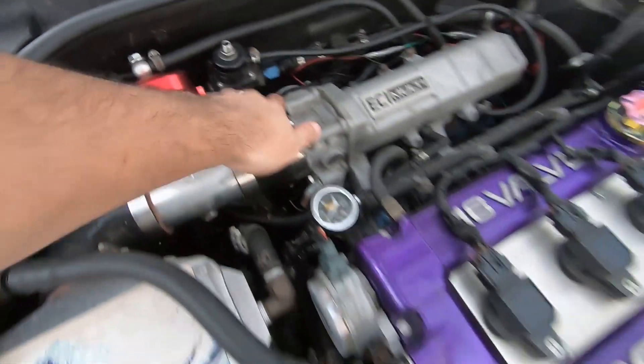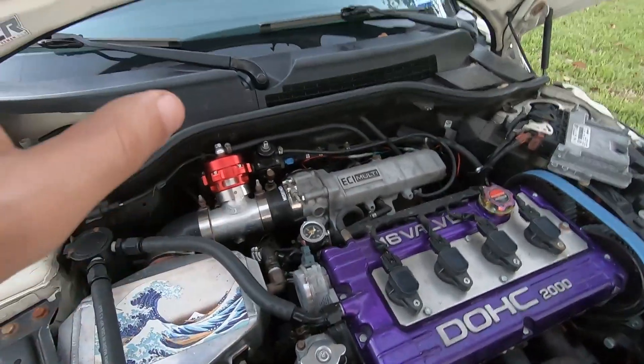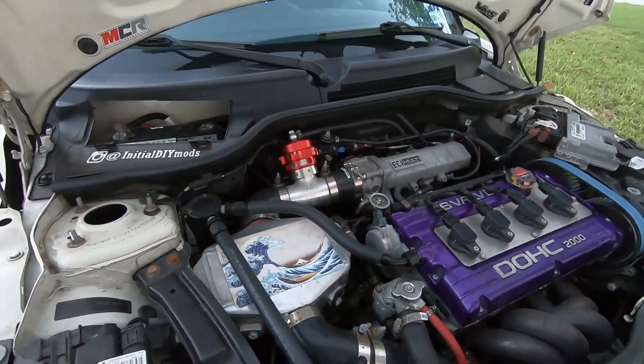On the throttle body side and inside the wiring, in terms of how it operates: this essentially mimics the throttle of a cable-driven throttle in the same level of functionality. Basically, you put 50% throttle, it gives you 50% throttle. It doesn't care about traction control, doesn't care about anything else. That's just the way that it operates.